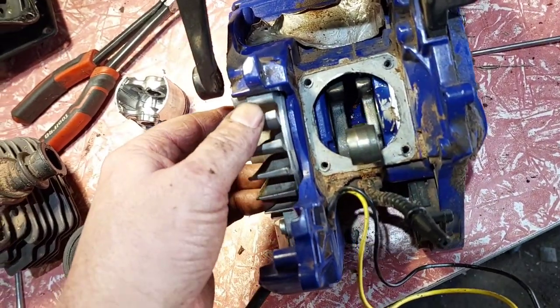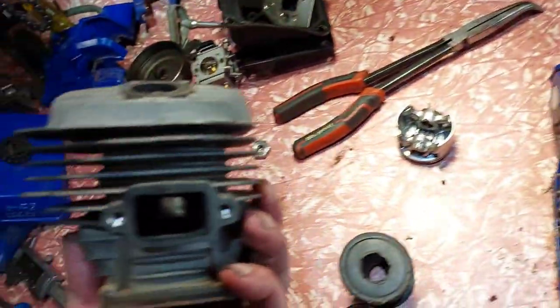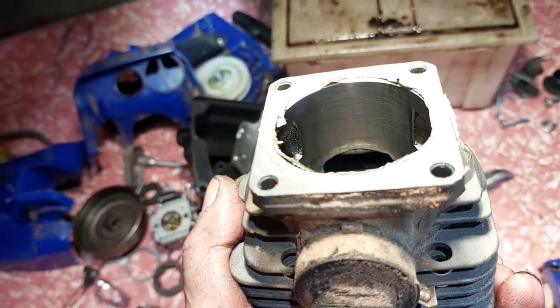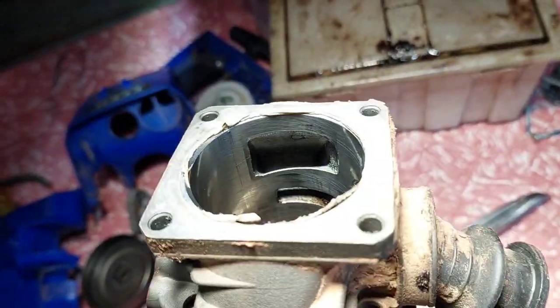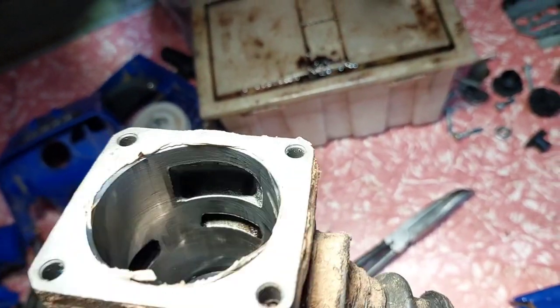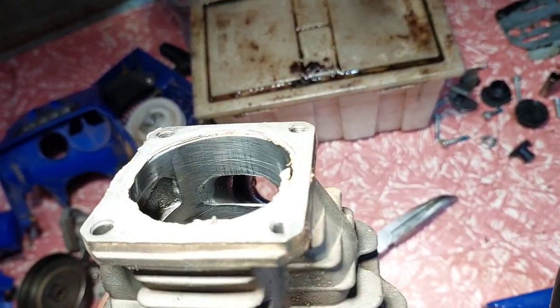That's one problem. The Stihl — I don't really like having a bit of crap down the cylinder, but I don't want to block it in there. Pull that out too. Looking at the exhaust — there's a lot of cross hatching, not much on the exhaust, a bit grotty looking. Not much oil. I'd make that a little bit wider. For the transfers — they got a bit wider, not much more. The intake — I'd say square off the arse, half a ring down on that, square it off, and I'll probably get about 76 degrees intake. I'd say I'm looking for about 74 to 75.